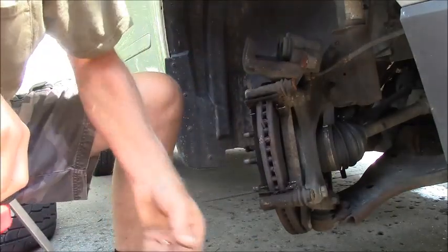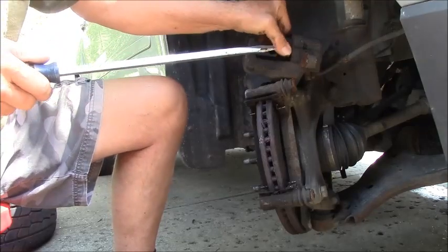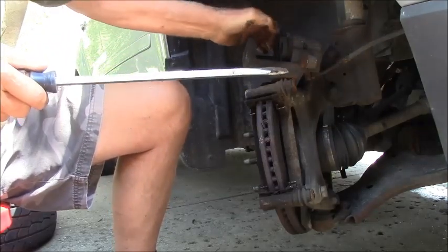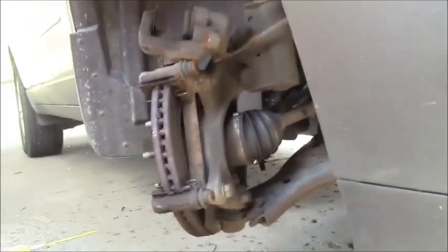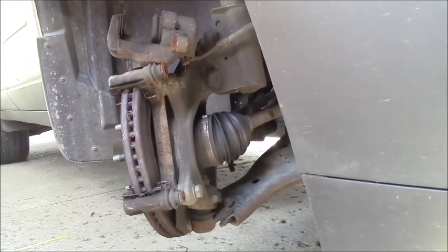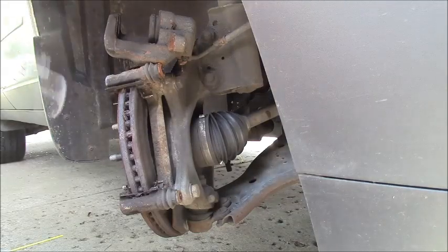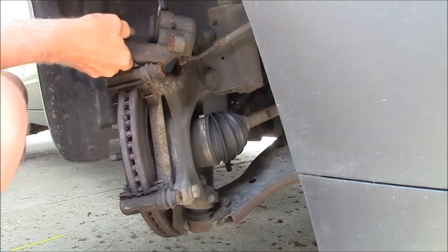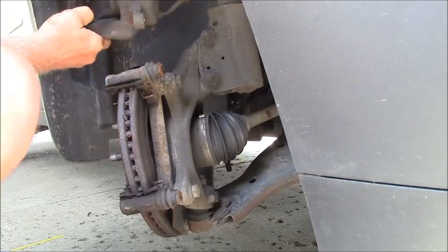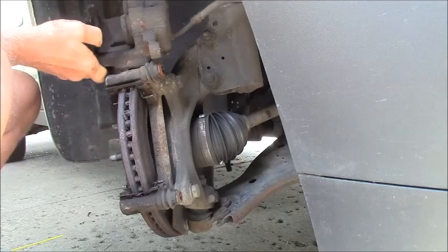We're just prying them out. I'm going to get a bungee and push these calipers back first. I'm going to spray them down with some silicone lubricant so they can go back in. The last thing you want to do is drop your caliper and have it bounce on the end of the brake hose. I'm just going to latch this guy up here for now.